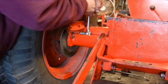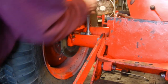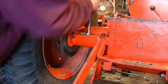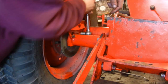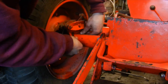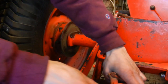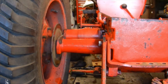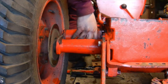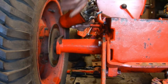So I'm going to take off the brake caliper on the back here. What they did is they roll-pinned the end of the axle inside the differential inside the transmission. So I'm going to knock the roll pin out, and if it works the way I think it does — which I hope it does — I can slide the axle out just enough to get this hydraulic motor off without having to pull off the entire housing itself. Alright, roll pin's out. And there you have it folks — hydraulic motor's out.